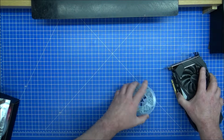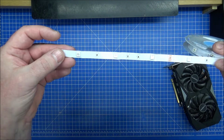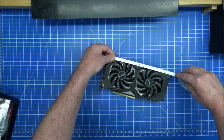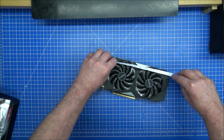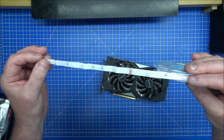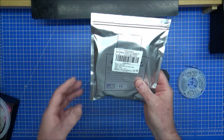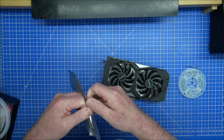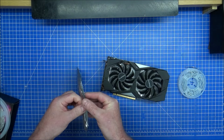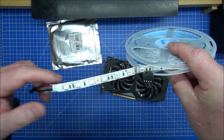So, yes. Lights. I could use these, they are 12 volts, but the gaps between, there's 3 LEDs per strip that you can cut. So if I did that on there, I could probably bend that around. I might just be able to squeeze 5 LEDs onto a straight, which probably will be fine. However, I bought these, which are 12 volts, which is good. Bought these in a bag, 5 meters, can always do with LEDs. Oh, come out. So as you see the difference, there's a lot more LED for your buck.